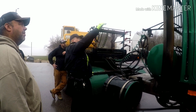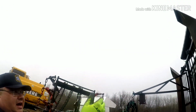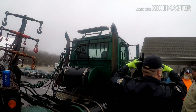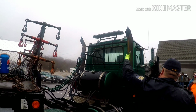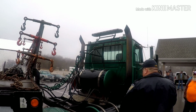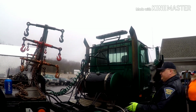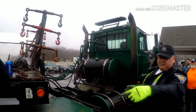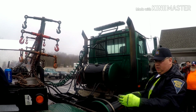So now we're looking at the reflective material on the back side of the tractor. As we're starting our way down, you can see there's some white reflectors there on the cab. And if you have any box trailers, you're required to have white on white L's, 12 inch by 12 inch, on point at the highest extremities. Those are required on the back. As well as, what year's this truck, Mike? 99. So anything newer than a 97 is going to require red and white reflective material on the mud flap brackets or somewhere on the rear.